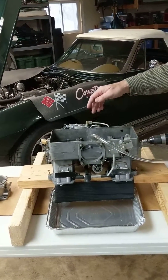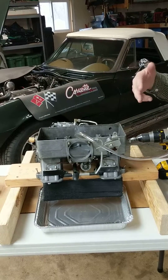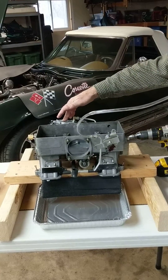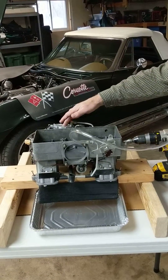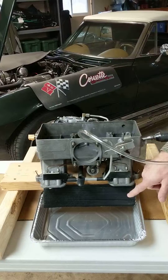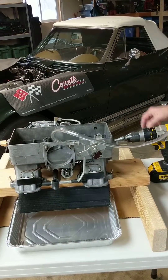The main enrichment diaphragm will be at the power stop because we have no engine vacuum, so there'll be no engine vacuum to pull that off the power stop. The main control diaphragm I'm going to control by just sucking on this hose to simulate the Venturi vacuum. And we're going to start by powering this high pressure pump with a drill motor. You'll see that initially the nozzles will be a low pressure squirt, which would be normally at an idle setting, and then as soon as I suck on this hose, you'll see the difference in the pressure.